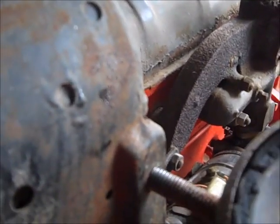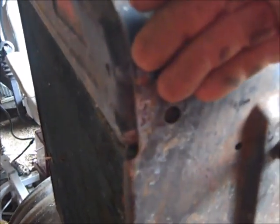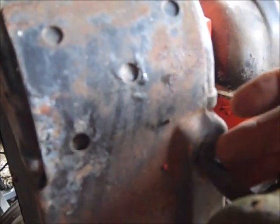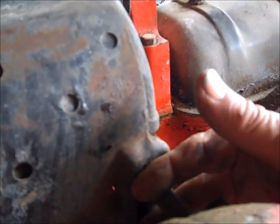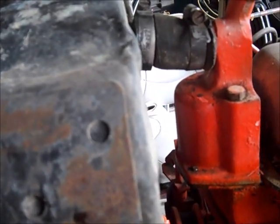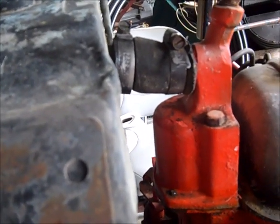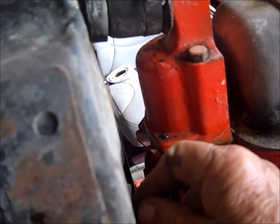Yeah, that's the way the lights on a B or a C go. You put the cowl on first, and then you put the hood on. After you get the hood on, you've got a lock nut here that tightens up last, after you get everything put together. Then the wire comes through and hooks up to here, and your wiring from your harness hooks to there to make the lights work. So it looked like it was about necessary if you wanted it done right.